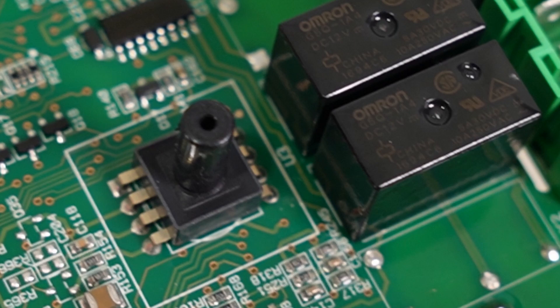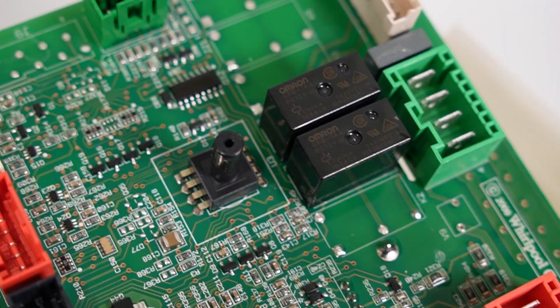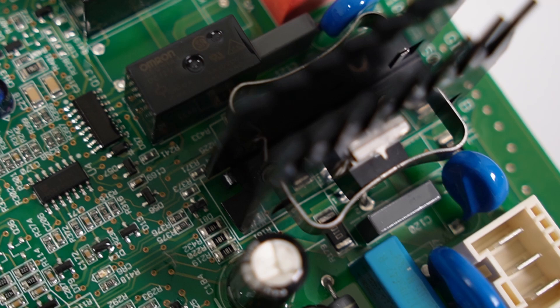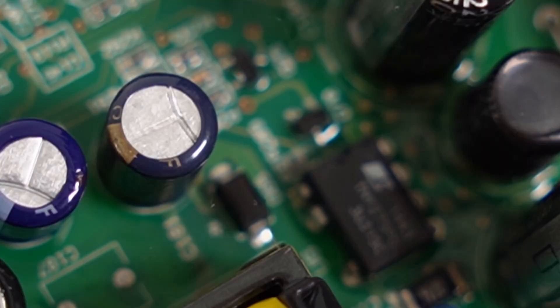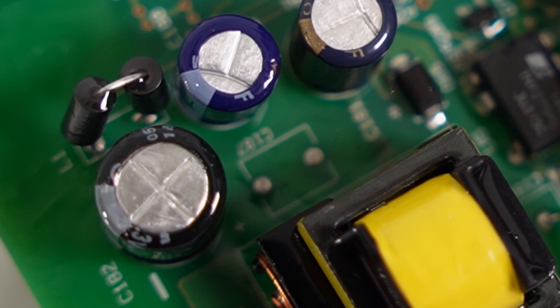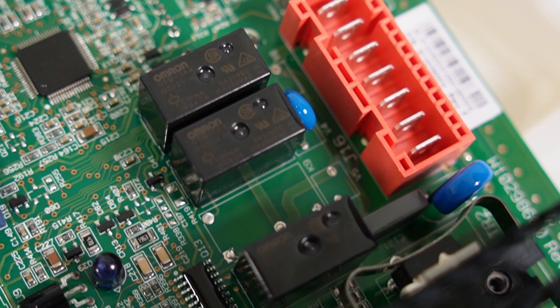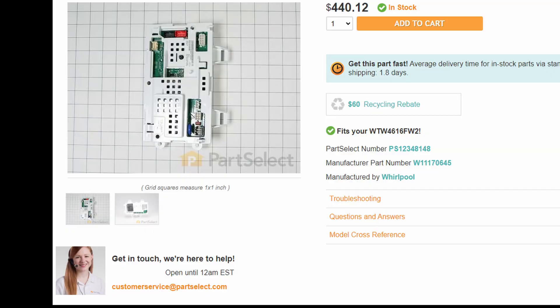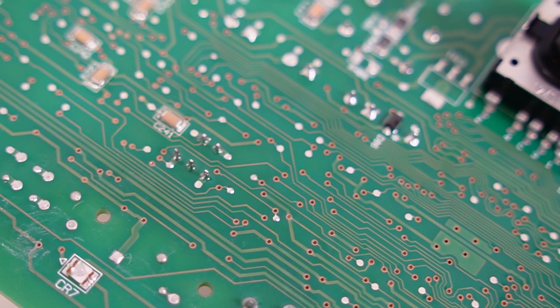Relays fire and eventually fail if they get run too many times and overheat. The biggest problem of an electronic control board is that it's only as good as its worst component. If any one of these hundreds of bits and bobbles fails, the electronic control board is going to stop working entirely. We've worked on these boards enough to know personally that this capacitor here is undersized and goes out somewhat often, causing the entire board to fail. And this relay that deals with the drain pump could fuse the contacts together. If either of these small components break, 90% — maybe even 99% of techs — will tell the homeowner to replace the $299 board rather than the $4.99 relay or capacitor.